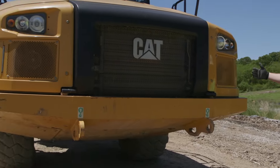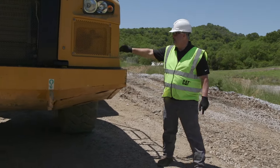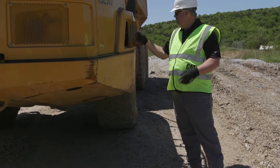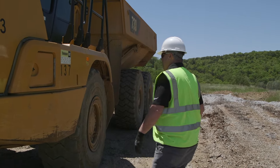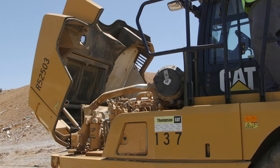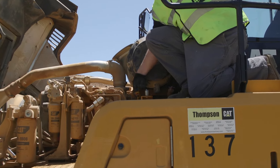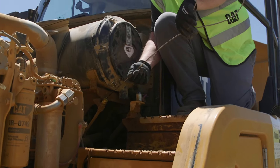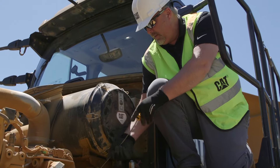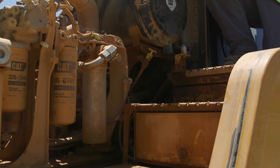As I come back around to the front, I'm looking at the grill for any damage, looking at the lights for any damage, and then that brings me back to the front side where I started. Now I'm going to put my key back in, turn my disconnect back on, and go up top and open the hood. We'll check our engine oil — here's my dipstick for my engine oil with a little clip in place. We also have my air filter up here.